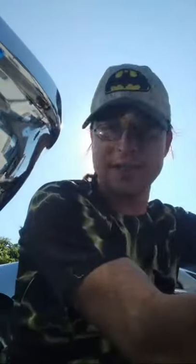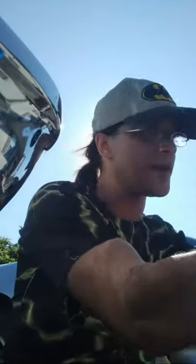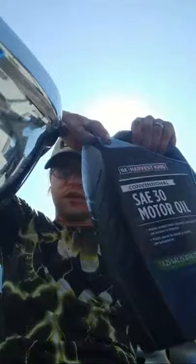I'm a little early today because I wanted to get out here and do some work with Project Spirit, and I wanted to bring you all along. Now, what I'm actually doing is opening up the case of motor oil. I'm going to stick my finger down in the motor oil, and we're going to coat it up real good with brand new oil. Then you dab that onto the filter, right on the new gasket.